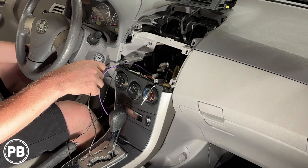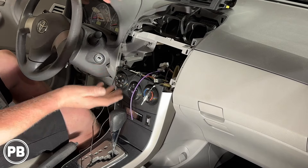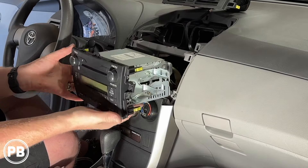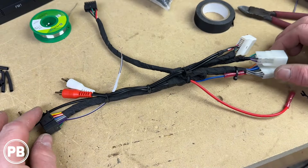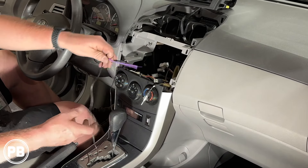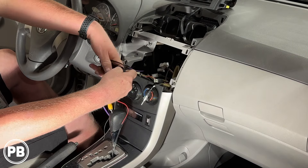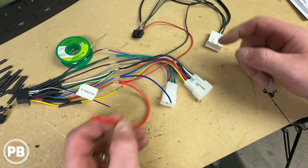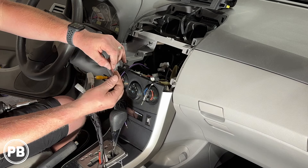We route the wire below the steering column along factory wiring, zip-tie it, and pull it up into the dash. The radio was previously removed, as covered in our first video where we replaced the factory double-din with an aftermarket Sony receiver — that video is linked in the description. With the radio out, we have access to our wiring. On our harness adapter we left an extra accessory wire out, and that will go to the repurposed trigger wire, which is now going to simply power the camera whenever the radio is on.